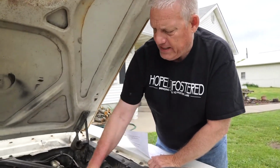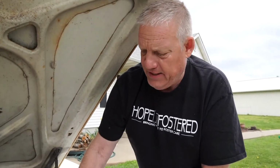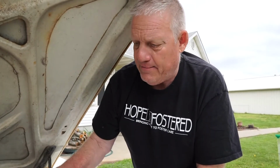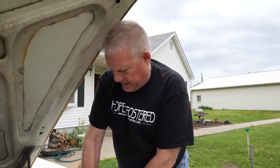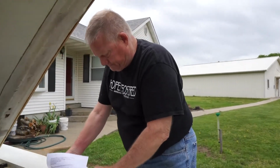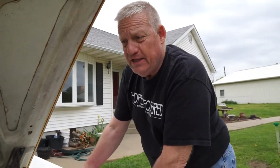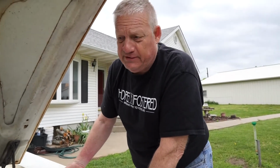Then inside here, we got Crane Gold 1.6 roller rockers, because with the cam and the piston and valve clearance, that's the biggest I can get. I've got a custom ground Oregon cam, number 722 on 108-degree lobe centers. And it's a real nice little cam, 222/050, and it's running about 492 on intake, 512 on exhaust, because that's what will fit with the SRP pistons.